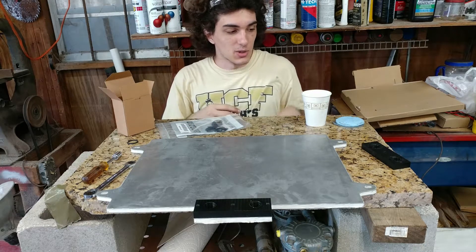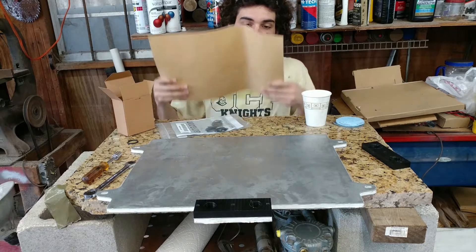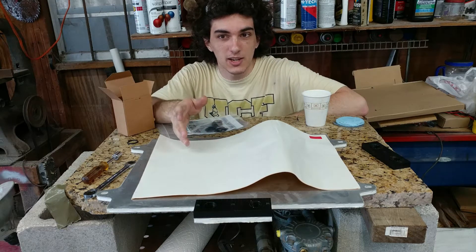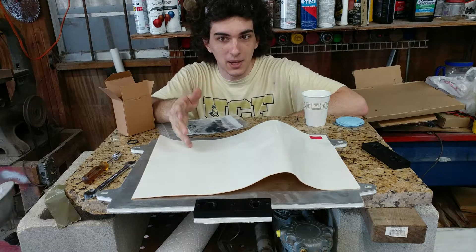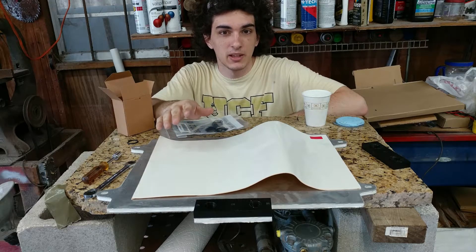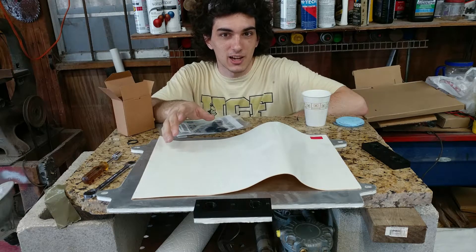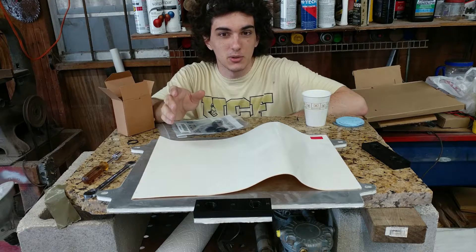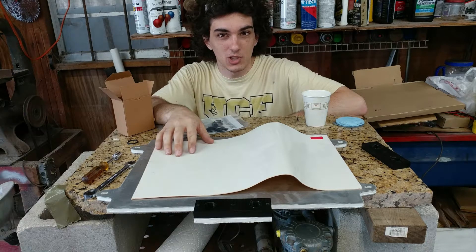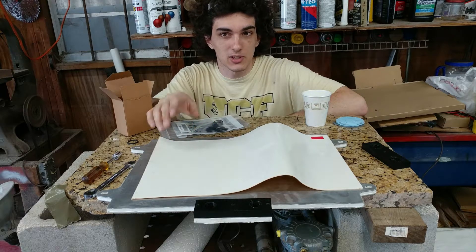Since making my own wasn't really workable and would have taken a very long time to manufacture, after watching a teardown of the Chevy Bolt battery I noticed they have thermal pads that are individually replaceable parts. So I left a comment on the video asking if the guy knew the part number for those, and he did. I was able to order a whole bunch of these from GM for a lot cheaper than generic versions I would have had to cut to size.